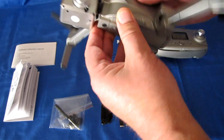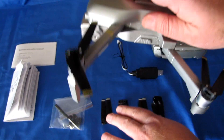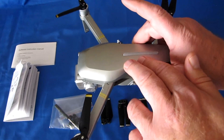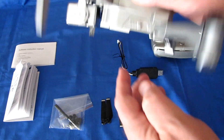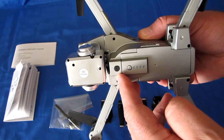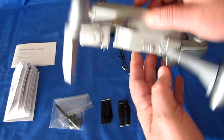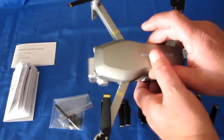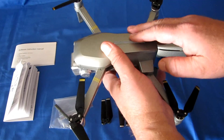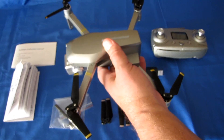We mentioned GPS. This also has an optical flow sensor on the belly, which looks directly at the ground beneath the drone and maintains the drone's position automatically when you're not using GPS. You can turn off the GPS and use this mainly for indoors. It will look at the ground and hold its position, though return to home won't work. It also has an altitude hold barometer — a pressure sensor that helps maintain the drone's altitude.